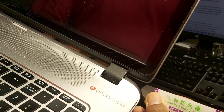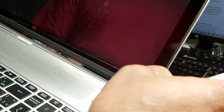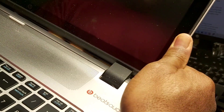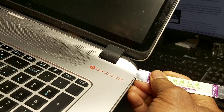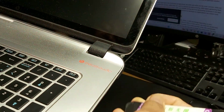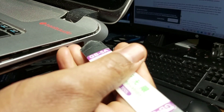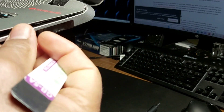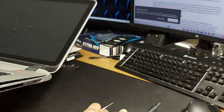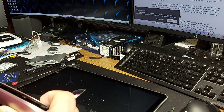This pry tool is very important. Look for small gaps between the cover, and at the beginning it's not gonna be a lot. Start even in the center right there, be careful not to damage your screen — push your screen out of the way — and start popping it up. Be careful especially around the area where the CD drive came from, as it's very thin there.